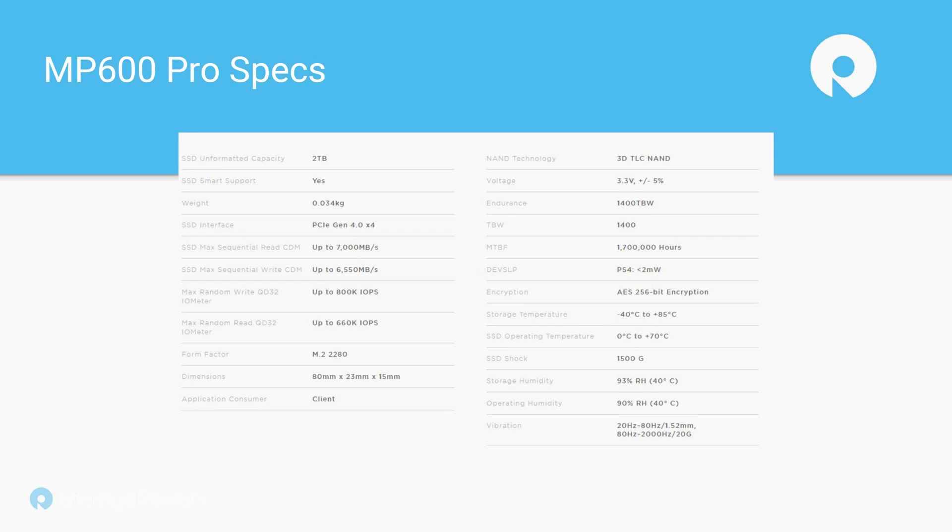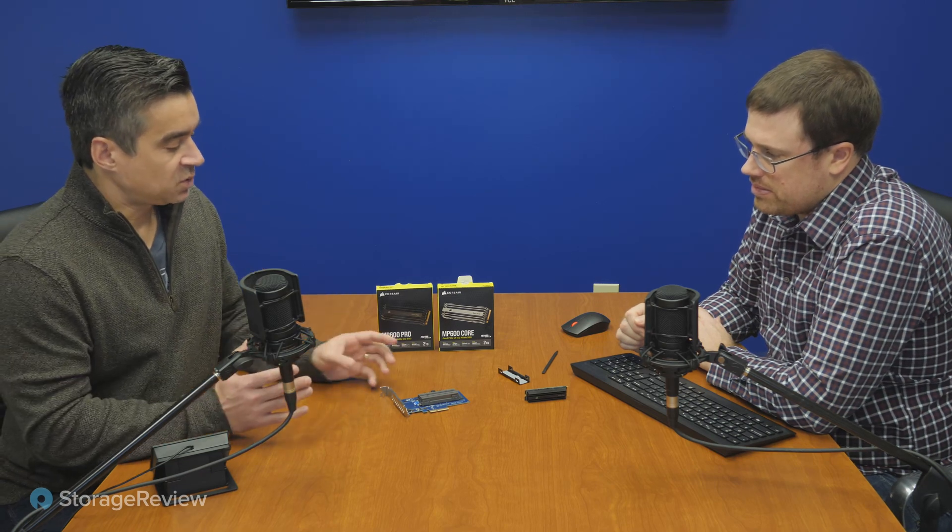The usability difference is significant. You can hammer the TLC drive any way you want and it's going to perform pretty well. With the QLC drive, if you write too much to it or you're moving around a lot of data — like an entire game installation — you're probably going to slow down the drive dramatically. Watch out when moving many, many gigabytes of data at a time.